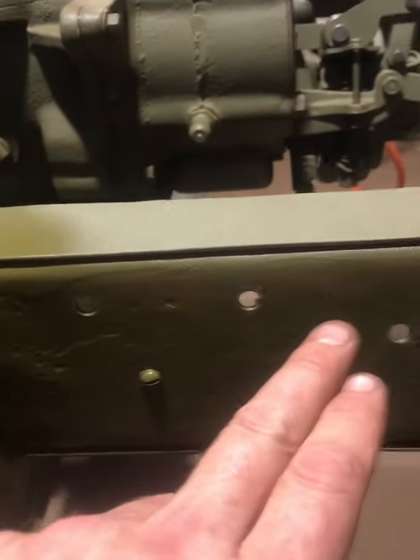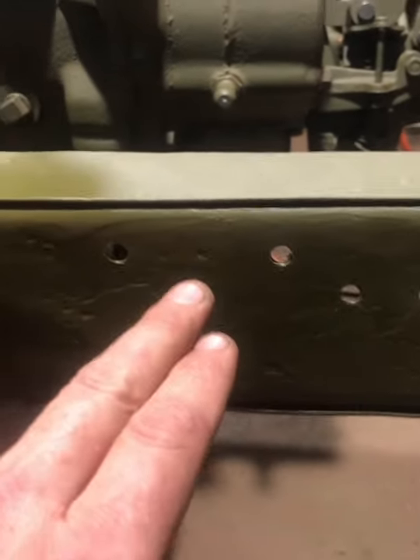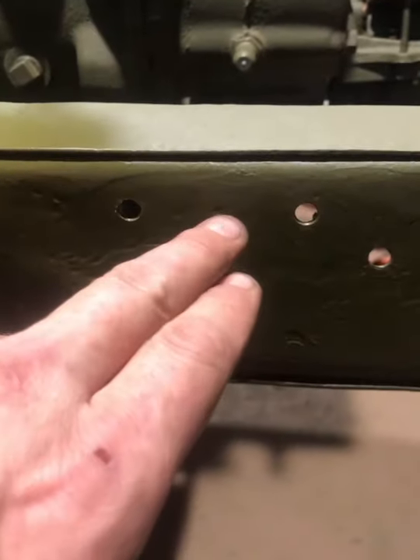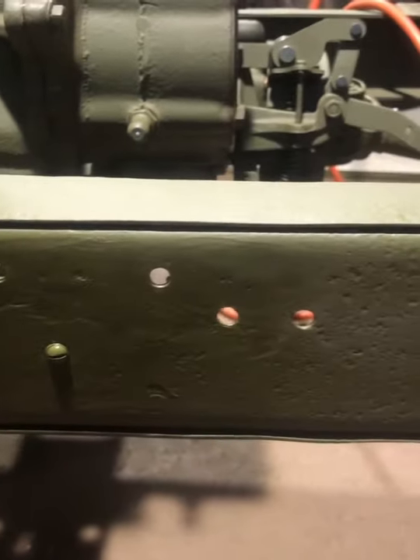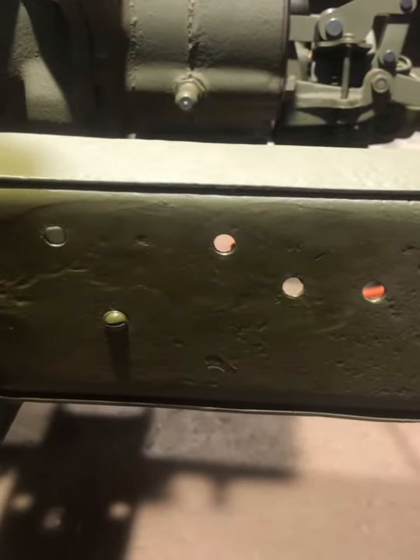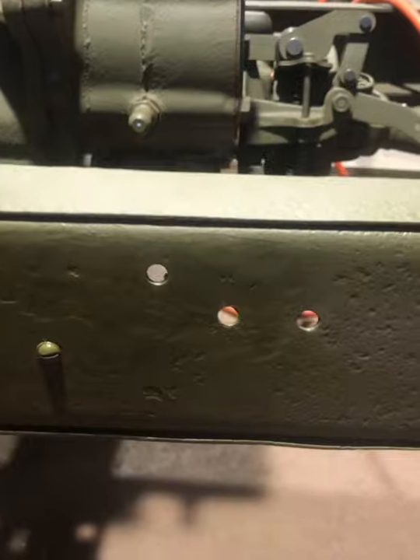I finished the mod. As I was speaking previously, I had to move the holes three and a half centimeters forward. You can look closely and see where I've spot welded them up — you can see slightly there, though one you probably can't see. I'm just waiting on the paint to dry and then I'm going to install the clutch control tube.